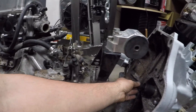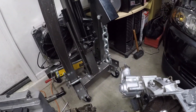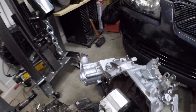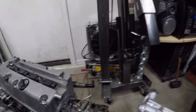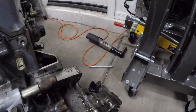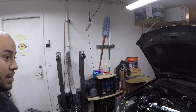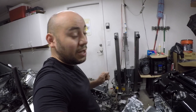It's pretty nasty inside — you guys have seen previous videos of me trying to clean it up. I did replace the axle seals so those should be all good. This bracket right here is about the same. So let's jump into the vehicle speed sensor: the front-wheel-drive is ran off that, and the CRV all-wheel drive is also VSS — the vehicle speed sensor — so you should have no issues using the CRV all-wheel drive.